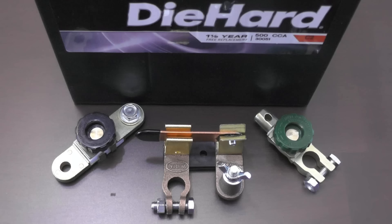This is a sample of a few popular automotive battery disconnect switches. Some come with installation instructions, some do not. In any case, always connect these disconnect switches to the negative terminal of your battery.